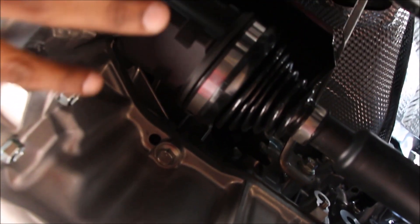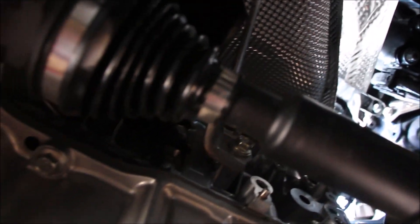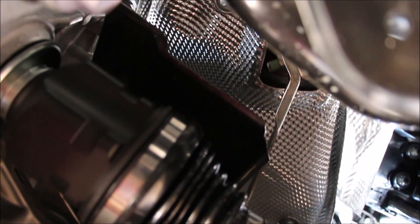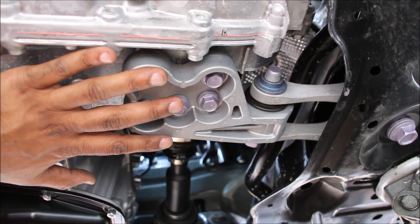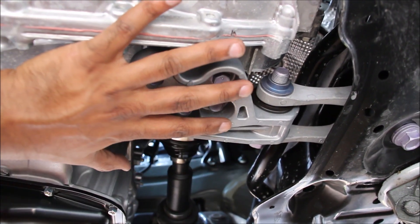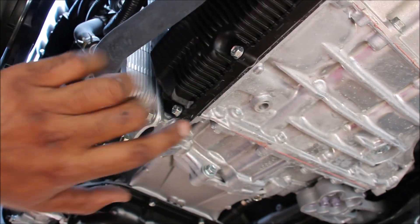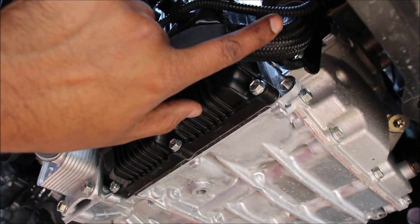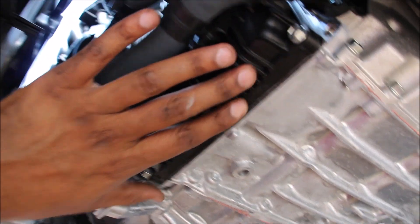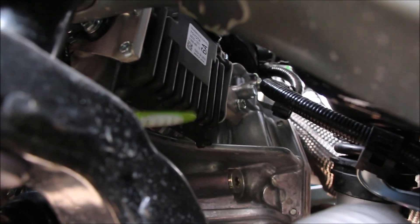Looking further up from the oil pan we can see the CV axle coming out of the differential in the transmission. Further up against the firewall is the ABS motor, and we've also got this exhaust manifold — this big foil-wrapped piece that comes off the engine — with a catalytic converter hidden underneath it before it goes back. This vehicle has three engine mounts: one on either side and one underneath. The bottom mount is made of an alloy material designed to break in a collision, dropping the engine and transmission assembly down underneath the vehicle instead of into the firewall. We've also got a good view of the transmission, with the cooler, the electronically controlled valve, the valve body, the drain plug, and the transmission control unit at the rear of the transmission.